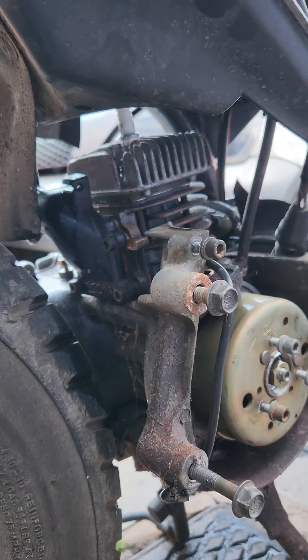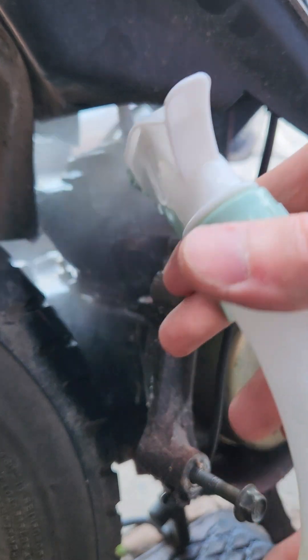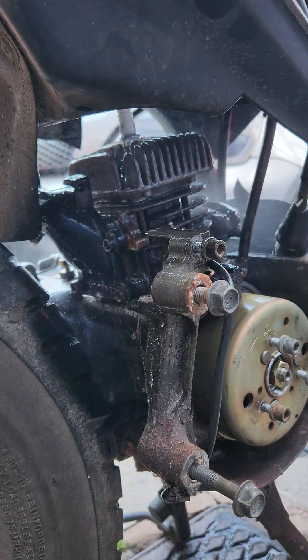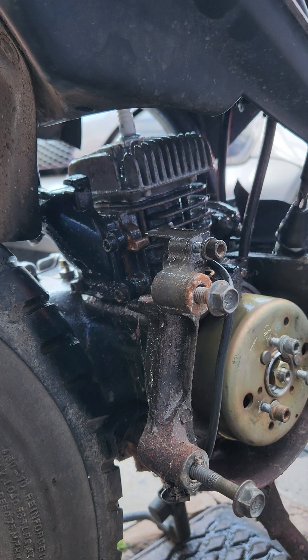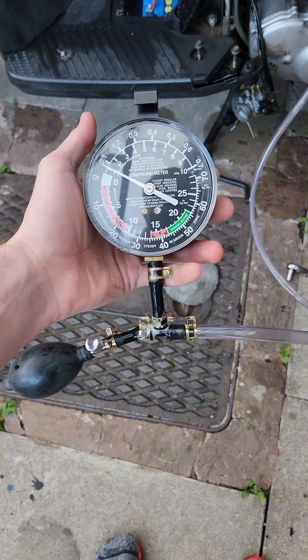A pinhole in the cylinder casing is a common flaw on Stage Six parts. If you go watch Mock Boys on YouTube, you'll see him finding plenty of air leaks on a lot of his builds — it's usually Stage Six parts — and he always fixes them with a bit of Honda Bond or JB Weld. So I'm going to reseal that intake manifold, and once it's set after 24 hours, I'm going to continue checking if there are any more air leaks, and then hopefully we can start to get this bike running properly.